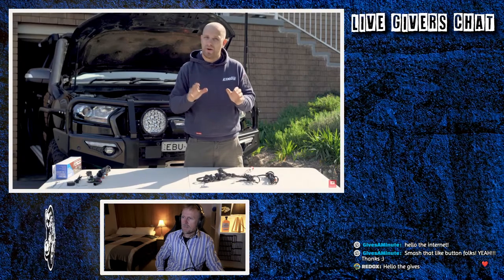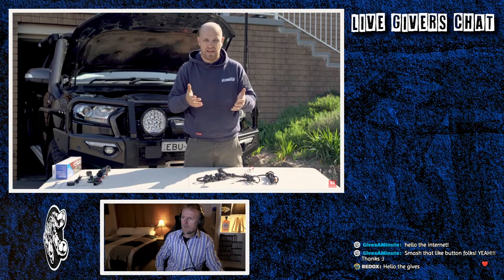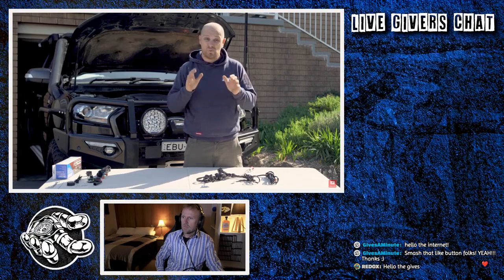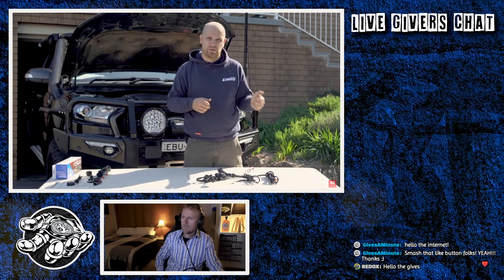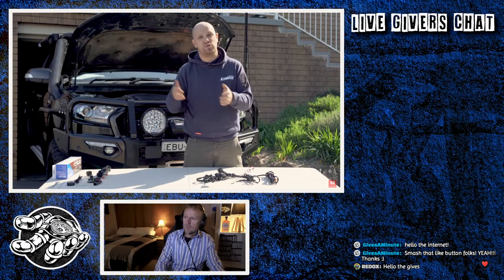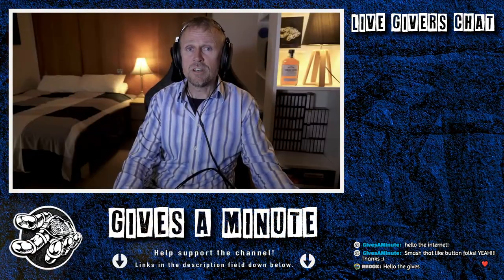Now, we've designed this harness to ensure that your driving lights or light bar remain completely legal when this is installed. And for that to happen, a couple of things must happen. First of all, your light bar or your driving lights have to only be able to be turned on with your high beam stalk, and canceled when you turn your high beams off. But as well, they need to be able to be separately switched so that even if you have your high beams on, you can still turn them off and just use your normal high beams. I guess that must be a registration or a regulation in Australia.